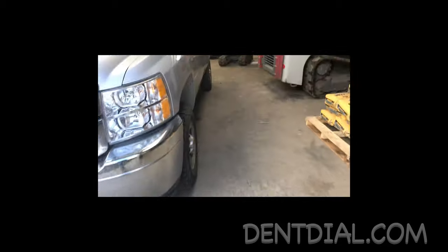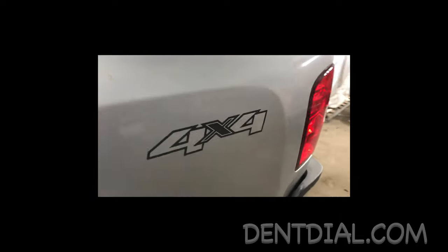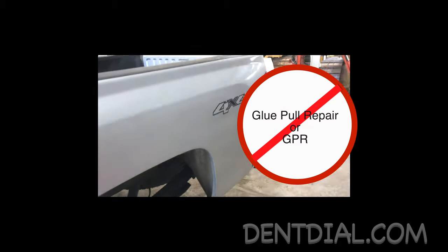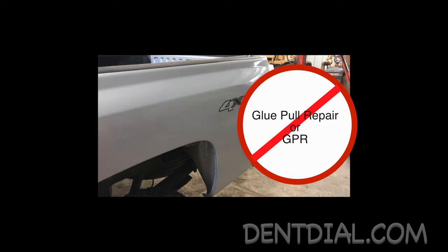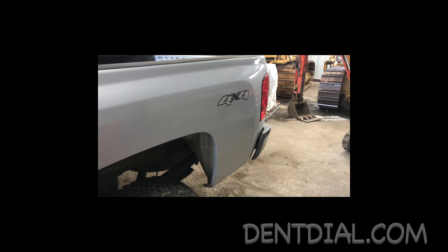Before I take off — you go from job to job, you gotta do these pretty fast. And this came out really nice. Now for a repaint, no Bondo. It's a farm truck and it's been repainted before. That's the life of a PDR person, just going from job to job — you do your best to do them fast and quick and get on with it. That's done. That's how you make money. Without glue pulling, it's a repaint, and without coming in from the top via the top cap — get underneath it. Tooling gets it done. Thanks for watching.